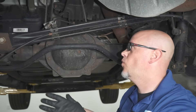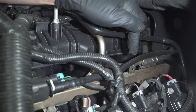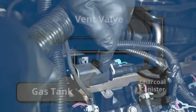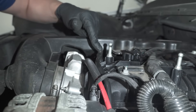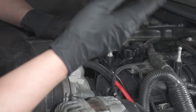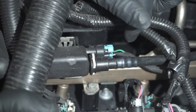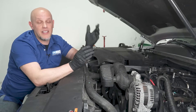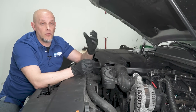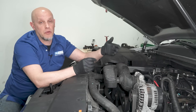Now you know how all these parts work. There's one more hose right here that goes to the front of the vehicle and attaches to the purge valve. Under the hood, we can see this hose coming up from the back of the vehicle going to the purge solenoid valve right here, and a hose goes right there where it gets its vacuum from the intake of the engine — when the engine's running you have vacuum there. There's a connector with two wires so the computer can command it open and close when the system requires vacuum. To put it simply, it's a valve that opens and closes. When it fails, most of the time it's not gonna seal properly and you can get a code for a small leak or even a purge when not required.